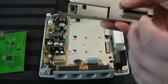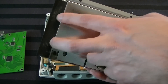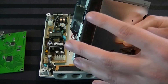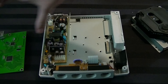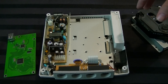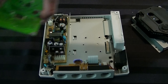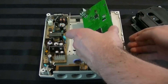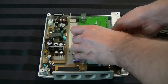If you flip it around, you'll see what I'm talking about. There's three screw points right here, but there's actually two more buried under this thing, which you would have to basically rip off in order for them to be accessible. Once you do that, you could take this frame apart and then encase it around this board like you're properly supposed to. Since I don't have any dead GD-ROMs, I don't want to do that. So you don't have to — it's not essential. You could just install it by connecting it here and putting enough pressure on this thing. And there you go — it's installed.